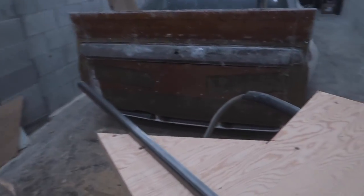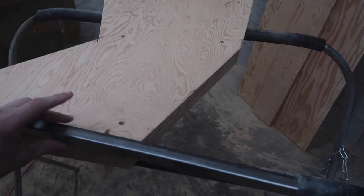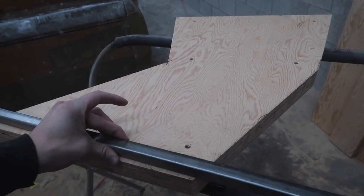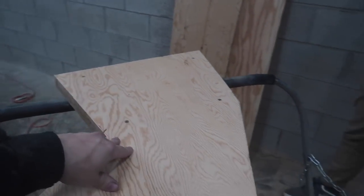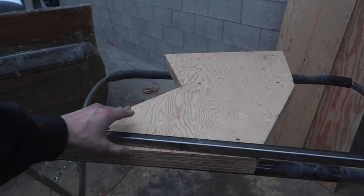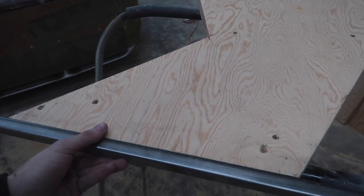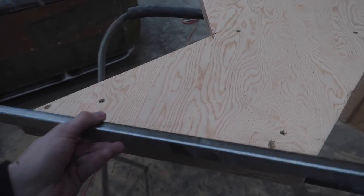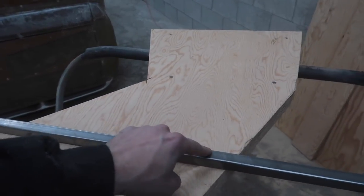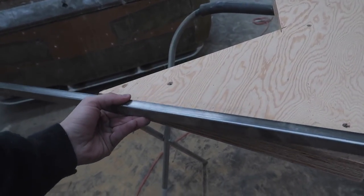So now we're at the point where we're gonna have to start clearancing for the metal at the bottom. We're gonna be using this 3/4 inch square tubing, which is the exact same size as the plywood. And that way we give ourselves 1/8 of an inch on either side for glasswork and bodywork. We're gonna be using this on the bottom, and we're going to not only glass it in, but we're also gonna drill holes here to be able to fit screws through it, through the metal, and screw it into the plywood,